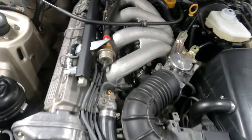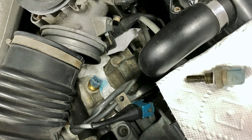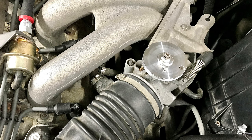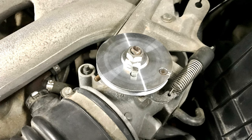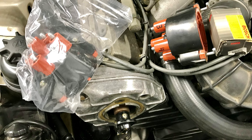About a month later, the car began to exhibit a low idle at cold start, and the DME temperature sensor ended up testing bad, so I replaced it for $22. I also added an Only 944 throttle response cam for $30 to make the gas pedal more linear and eliminate the initial slow turning of the throttle. To improve the overall ignition response, I replaced the spark plugs for $15, along with the distributor cap and ignition rotor for $73.